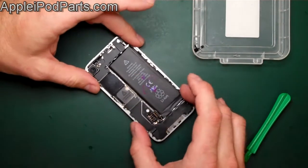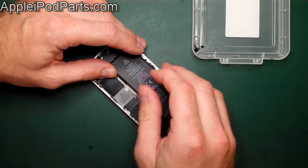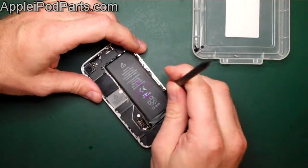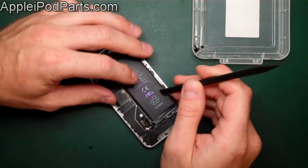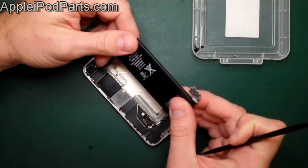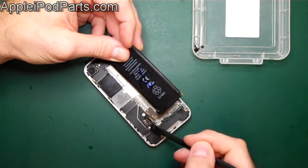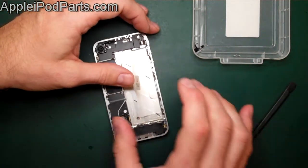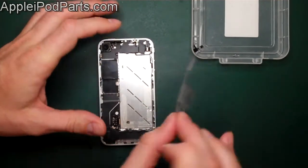The battery has a little tag saying 'pull here' to release it — sometimes it's extremely well stuck down. If needed, use a little plastic spudger tool to pry up from one side, being careful not to damage the battery. A little bit of warmth can help, but don't overheat the battery or the phone. Once the battery is out, if you're doing a full strip down, the adhesive strip simply pulls off and you can push it back down later — just get it out of the way.